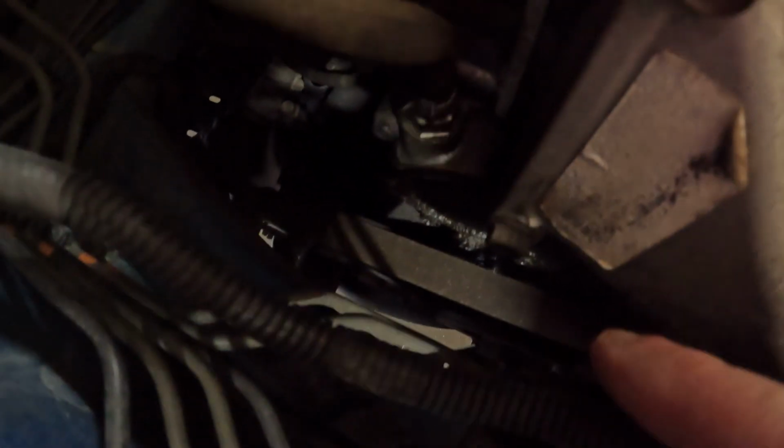As you can see, I don't know if you guys and girls out there can see this, but it was leaking oil pretty badly. You can see it right there, right above that belt. But all of this in here was covered. I sprayed it down with brake parts cleaner, and it ran out the bottom. The way I noticed it was leaking was actually I changed the oil, and it was leaking so bad it was coming out the bottom. So they say when this starts leaking, because it's such high pressure there, it's a pretty bad leak.